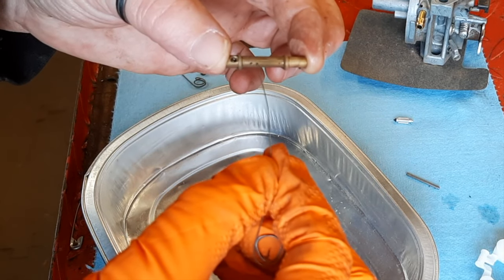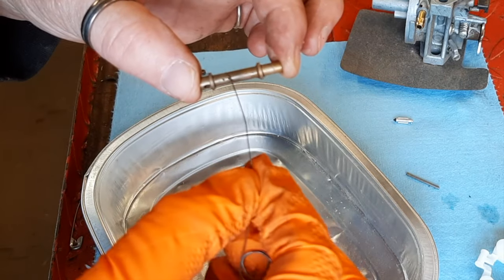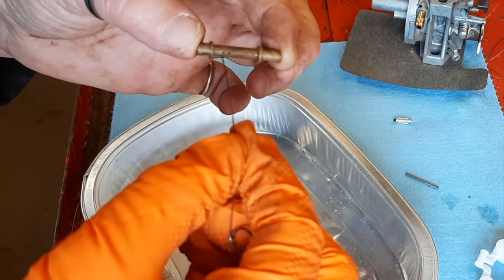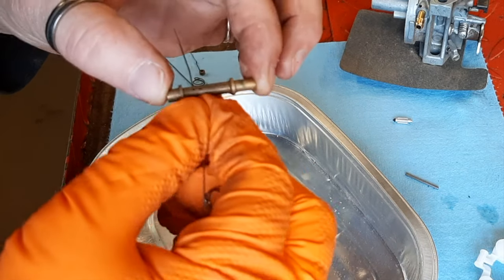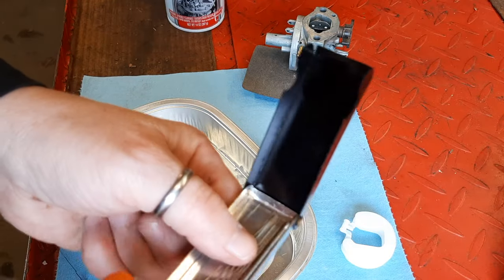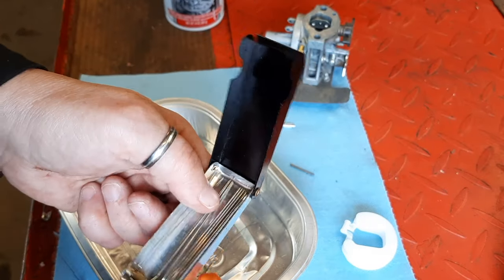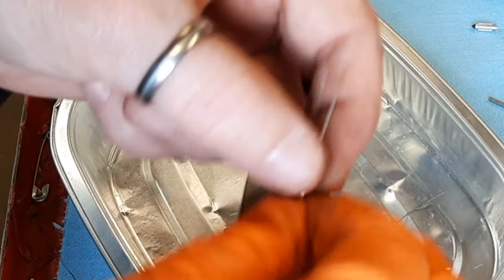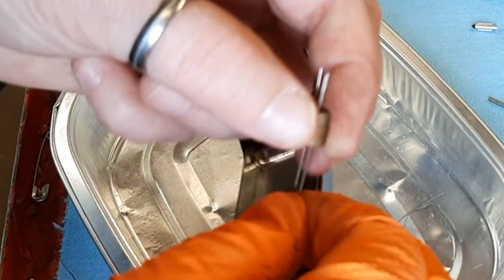And these are guitar strings. That feels kind of bad in there. That's kind of crunchy, as is that right there. And these are a welder's tip cleaners, just to get the size that just will barely fit in. These are almost like a little file. Make sure that jet is clean.